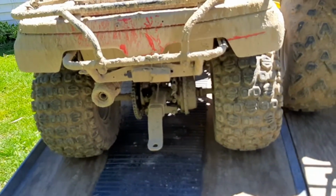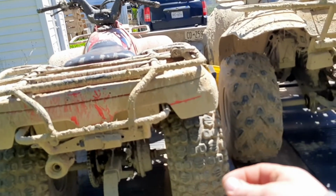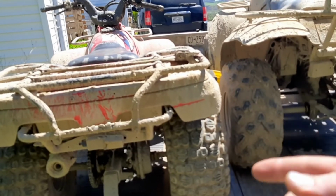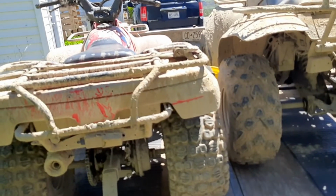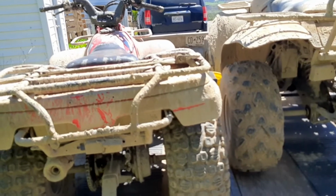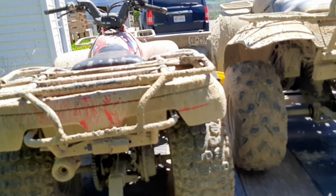They fit really tight in the drum. So I ended up, the bottom side sits on a pin, so each brake shoe's got a half circle cut out. So what I did is I put both shoes in the vise and drilled out the hole some, and then ground down the edges so that the bottom of the brake shoes sit closer together. So we went on and off with a drum a time or two.